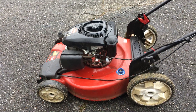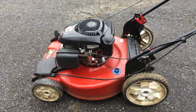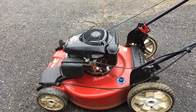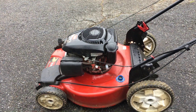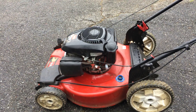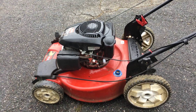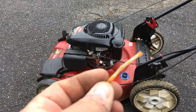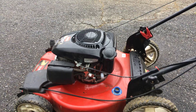Not really — it's rated at 75 microns. A micron is about 40 millionths of an inch, so 75 microns is about three thousandths of an inch in hole diameter. That's a good mesh size. I've seen it used on smaller things, and the mesh in this filter looks very, very fine. I figured I'd get something similar, and that filter was five bucks.